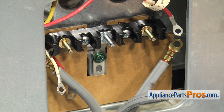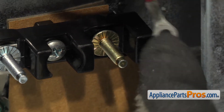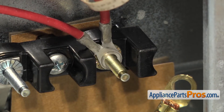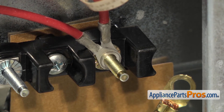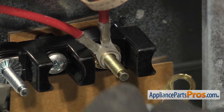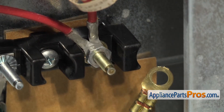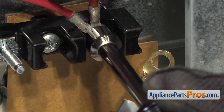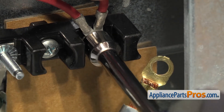Now we can go back around and put all the wires and the nuts on. We're going to start on the right-hand side — remember the two red wires were over here. As you tighten these down, you want to make sure you tighten them down pretty good. If you leave any of the nuts loose, you may cause arcing, which may cause it to fail again. So make sure you tighten the terminal nuts down nice and tight. We're going to use a 3/8 inch nut driver with a hollow shaft to reach down and tighten this nut down — the socket wasn't able to reach it. If you have a deep well socket, you can use that.